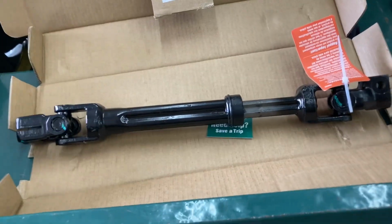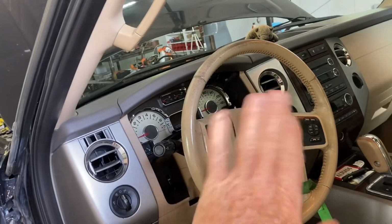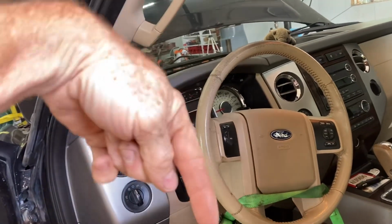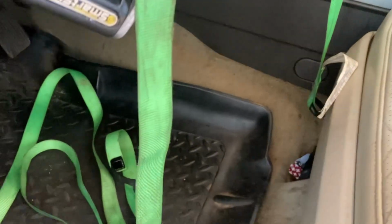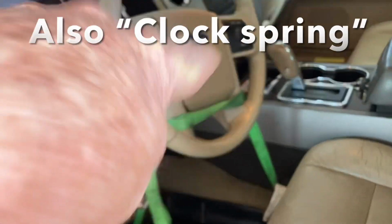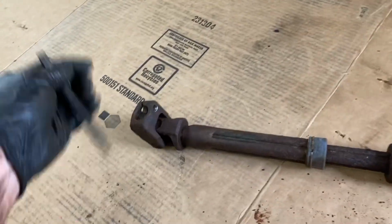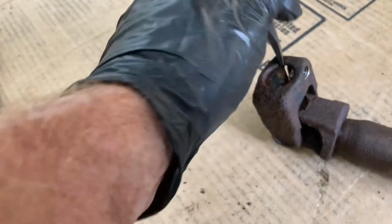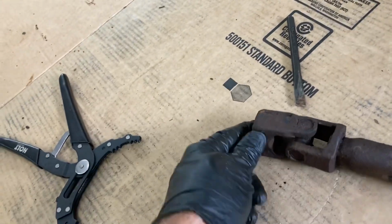So old one out, new one in. On this one, with the way the bolt is lined up, if you're off just a little bit from square, the bolt lines up real easy to where you can get to it from the top. I'm just using a little ratchet strap, putting a light amount of pressure so that I don't have any problems with the alignment or anything like that. So to get it out, I put the chisel in the top one, right in the little groove, and tapped it down so it was opening it up as it was putting pressure down, slid right off the shaft.